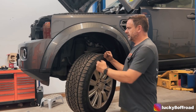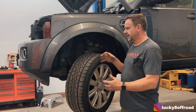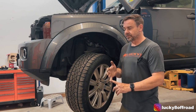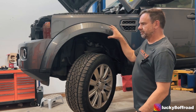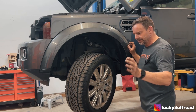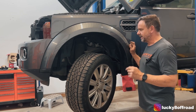Next up, I'm going to pop the tire off and get the inner fender lining pulled back. It's held on with a couple of those little pop clips and some Phillips screws. You want that out of your way so it's easy to release the tab that holds the lower flare on. We're going to work the flare off — I said you don't have to take it off, but I highly recommend you do. It's also held on over here with two little plastic clippies.